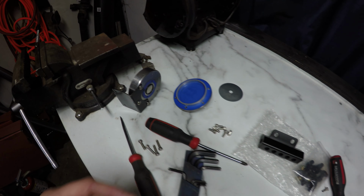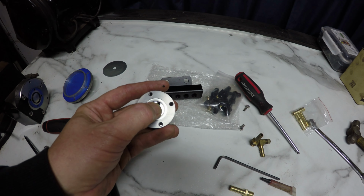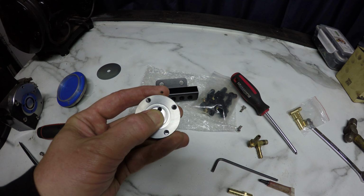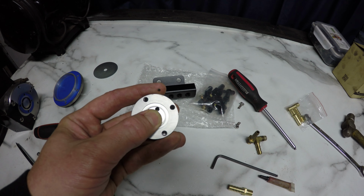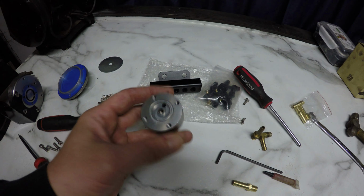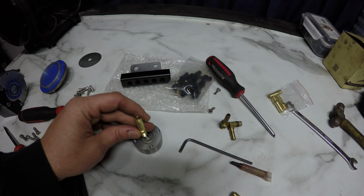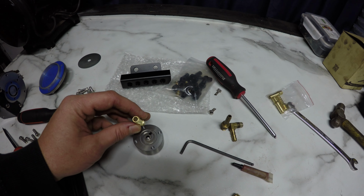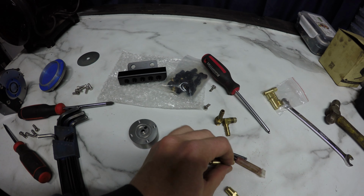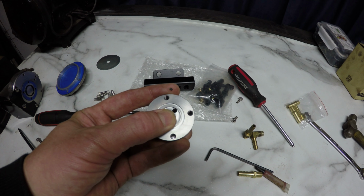I've got the fuel metering unit off and I've got it all apart. This secondary hole, the outer one, is the one that I would really like to open up to give it a little bit more porting. The center hole, I think, is actually probably 5/16. When I really lined it up there, the diameter might be a couple thousandths off, but it's really close. It's that outer hole, I can tell it's a little bit too small.